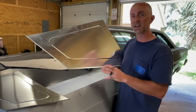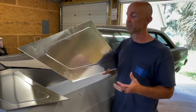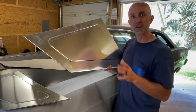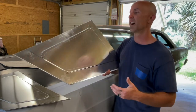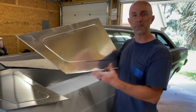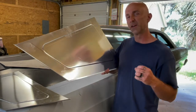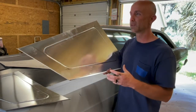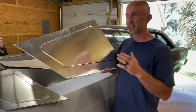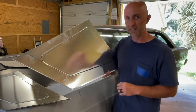And the brake is just to help tie it into the other sheet metal in the vehicle. When we go to final assembly, we'll use these brakes as an area to put silicone and caulk to seal up the interior so that you're not getting road debris and/or smoke from a burnout coming into the cab with the driver. Things like that also help keep vibration down on panels like this, which allow them to last a little bit longer. Metal, when it's moving and vibrating, is wearing out. It only has a limited life when it's vibrating like that.